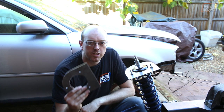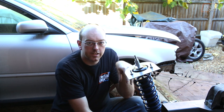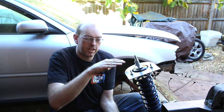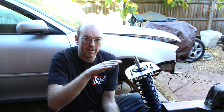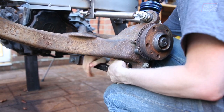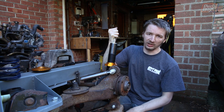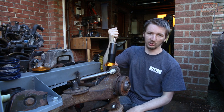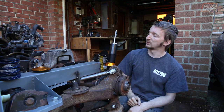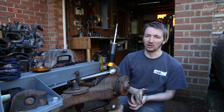We've taken one of the top mount pieces and attached it onto the strut so we can position it relative to the body. To work out how high the top of the turret needs to be, we extend the suspension as far as expected so that at full extension the spring is at the bottom of its travel. We've taken the bottom bolt out to address some binding, then taken the coilovers apart to measure travel — letting it go, it rolls up about five and a half inches, which is roughly our suspension travel.